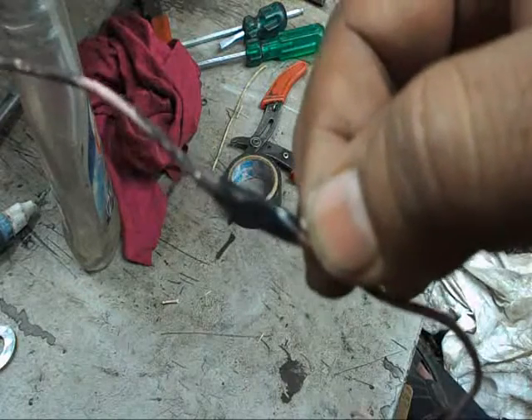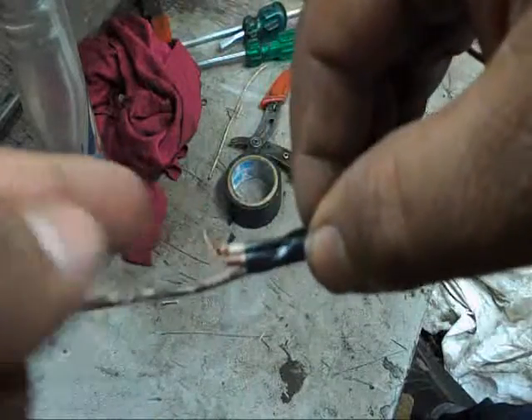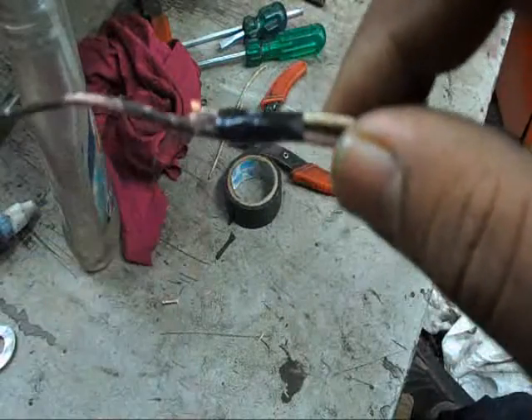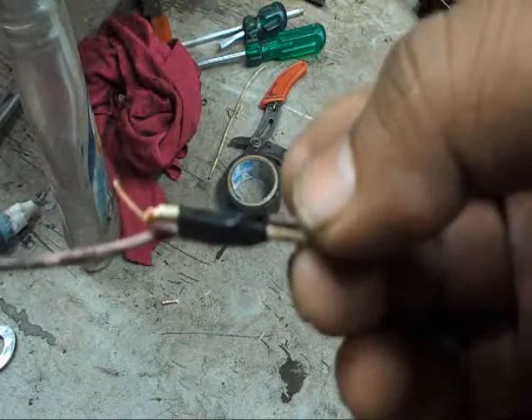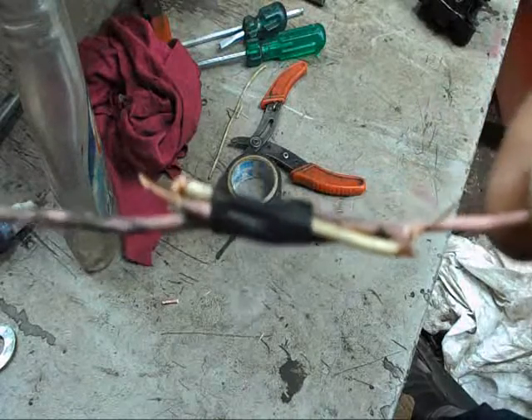If it is not blowing and you have ridden the bike for at least 100 km, that means the problem may have been in the fuse itself, but not necessarily always. Always check the root cause when working on electrics. I kept both terminals open, so you just have to use insulation tape here — this should not short circuit with the body or any other electrical equipment. Secure the temporary fuse with insulation tape and then start riding or check the root cause of the electrical short circuit. Thanks for watching, have a nice day.